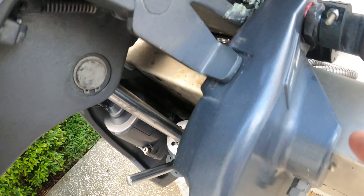There's a lot of work to do on it. I'm also having some issues with the power trim — I believe it's leaking right here. It's wet. I've been having to fill it up, so I think I can take out the trim and tilt unit and have it rebuilt.